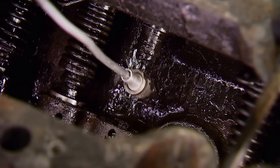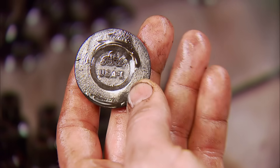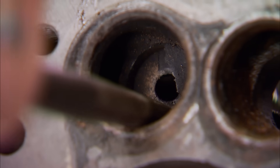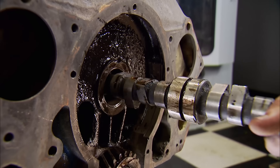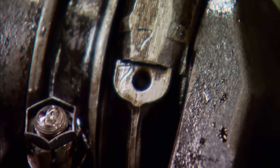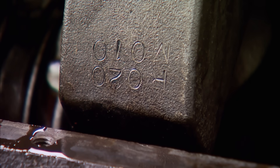Don't forget to find all your locks. Here's a sign the engine has been rebuilt in the past — the original intake valves have the Ford logo engraved into them. The exhaust valves should be smooth. This engine had some of the exhaust valves in the intake valve location. Now we can remove the lifters, and finally the flatty's cam. The rebuild is confirmed — had to be a quality one too with the stampings we found on the rods.